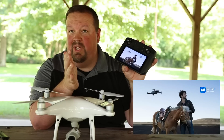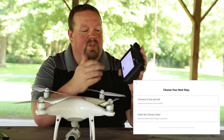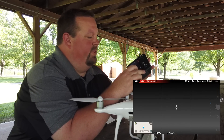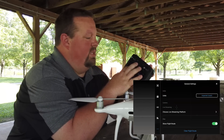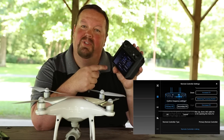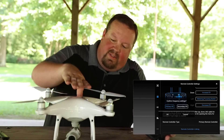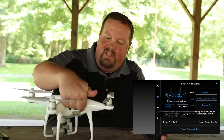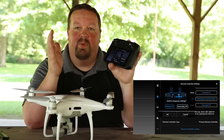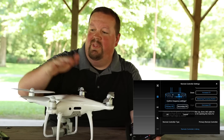The first step is you go into DJI Go 4, press Go, then just enter Device and enter the Camera View. Once you're in there, go into the menu at the top and choose the remote control icon. Scroll to the bottom, then choose the remote controller linking option. Once you choose that, there is a linking button that you have to use something pointy to press in order to link it. That's super simple — that's the way you've been doing it for ages with other remote controllers as well.